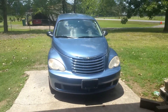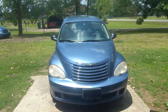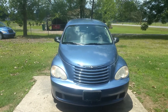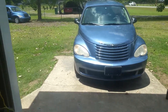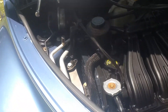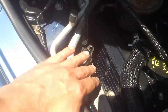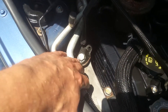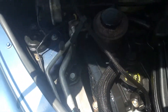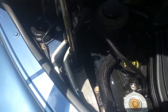Depending on the location of your AC line, some of them are a little more difficult to wiggle out of there than others. We're going to go ahead and get started here. We're going to need a 15 millimeter and an 18 and a little bit of an extension. So we're going to get on this 18 right here first. Sometimes these lines could be in the way depending on your car — these here are pretty much pushed over out of the way. So I've got an 18 extension and we're going to go ahead and just loosen that one up.